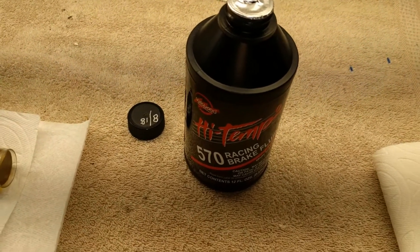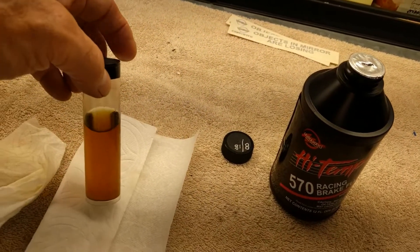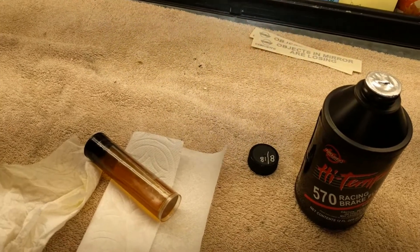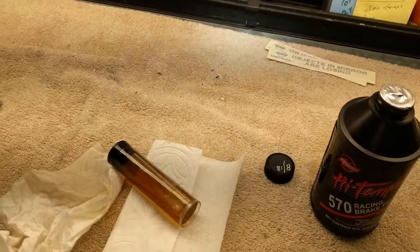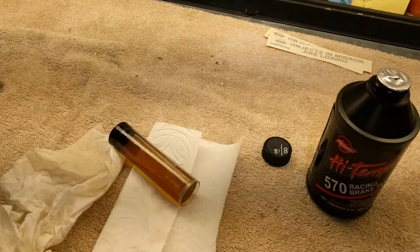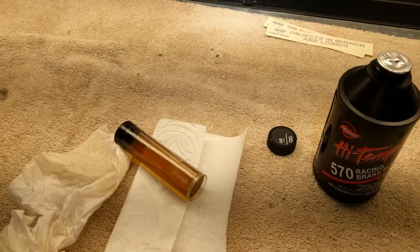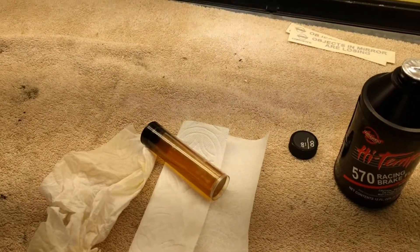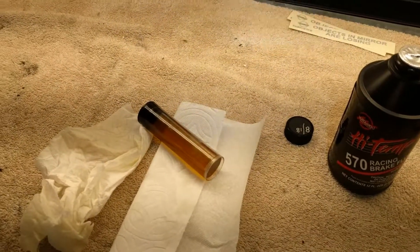I do this before every event — about two and a half to three ounces — and if you do that, you don't really ever have to do a full bleed. A full bleed is really a pain and almost impossible because you should bleed it down at the slave cylinder, which is a really big service procedure. They have remote bleeding kits you can install, but as you can imagine it's a big deal because the slave cylinder is buried way down in there. So do the Ranger method — frequent replacement of the reservoir fluid — and you'll be good for a long time.